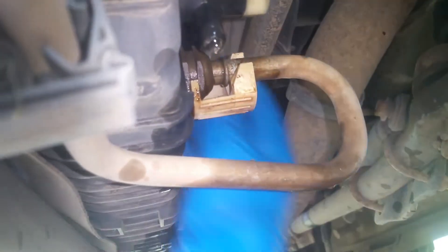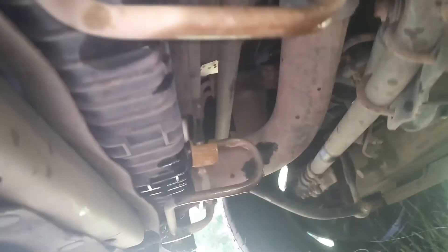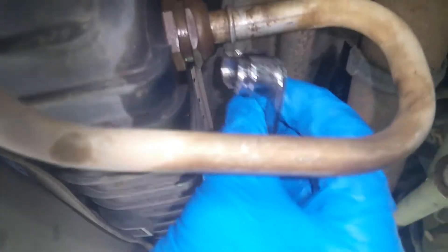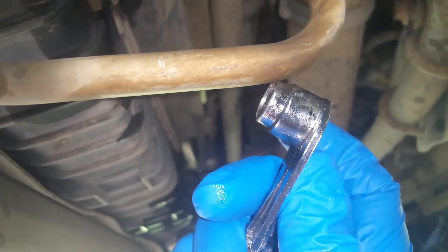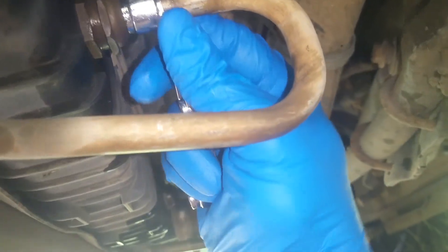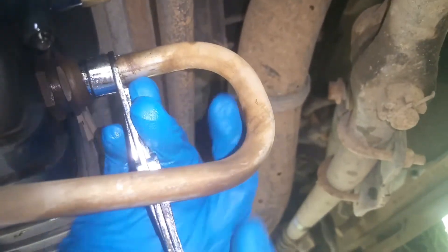With our coolant out, we're just going to pop this little clip here that helps hold that on there — just take that straight off. I'll do the same thing on that one down there. I've taken and sprayed those off with some brake cleaner, then put a little WD-40 around there. Notice it's a little bit bigger up here than it is at the bottom, so it allows it to go over this nub right here. So if I can slip it around it and give it a good push, then I'll just be able to pull that straight back.